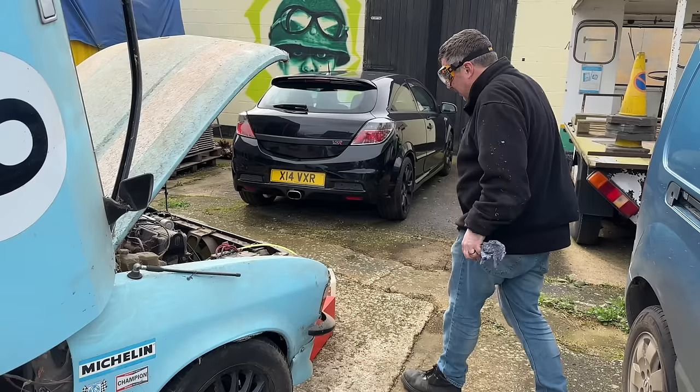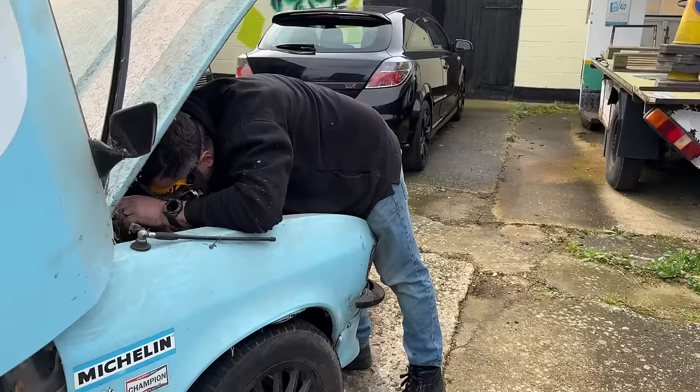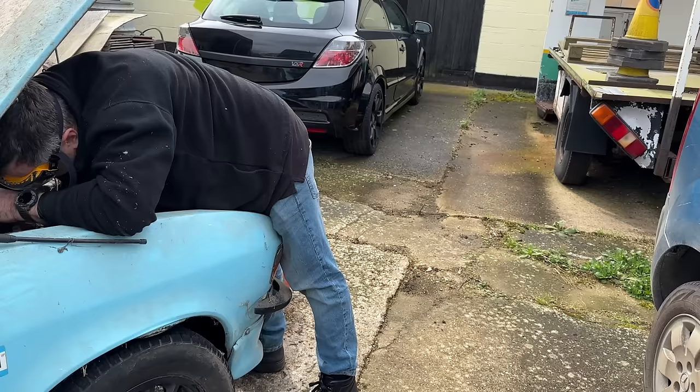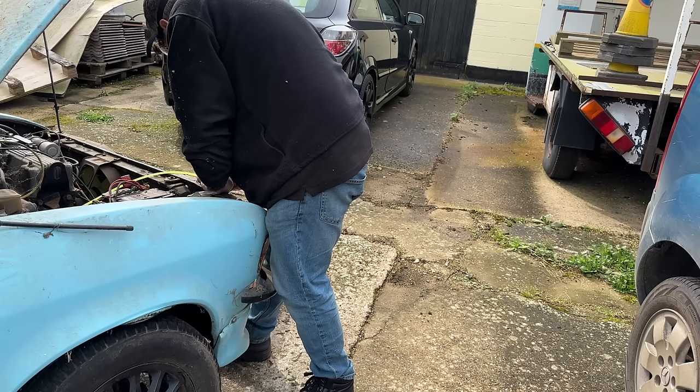I always used to overfill mine. I'm assuming I just. Well, just read the instructions for goodness sake. No, we'll be all right. Oh, God. You mean the instruction bit here where it says warning? Yeah, that one. Slide the valve to depressurise. Both the pressure and vacuum gauges are isolated during the depressurising sequence. Before opening the system on the vehicle, slide the valve to pressure to check the pressure is zero. Yeah, don't do that.